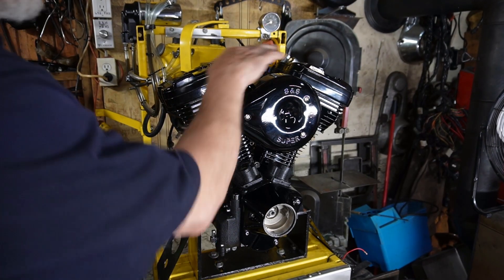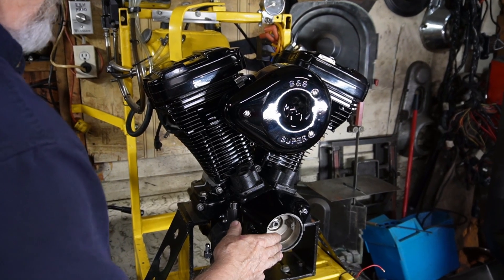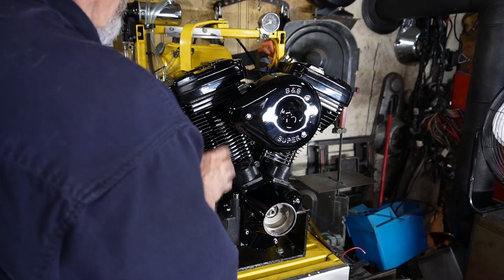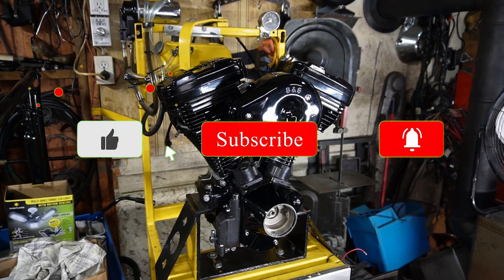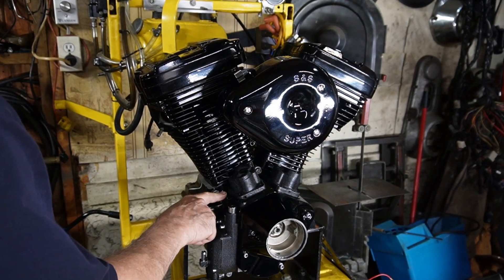So we got a few things to do yet, but I wanted to fit this up and make sure it all fits okay. We're gonna have to take this off, put a cam seal in, then time it, then put our ignition in. We've got push rod covers to go up in here which are all black. I just have to decide whether to go all black or put a little set of skulls on there just for fun. Either way they should look okay. We're getting there piece by piece. If you enjoyed this video today, please like, subscribe, and ring the bell to get notified. It helps our channel grow and we appreciate it. Please share it with your friends and hopefully we can bring you information that's entertaining and informative at the same time.